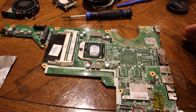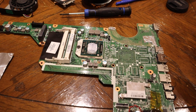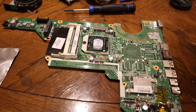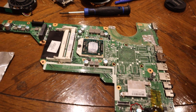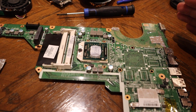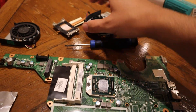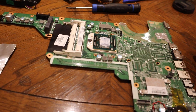My silver laptop did better - it was a newer laptop - but it finally got worn out, and I thought rather than buying a new laptop I really missed my old purple one and how well it worked. I did some stuff to it and the startup time went from 30 to 40 minutes running Windows to less than a minute. One of the things that helps is addressing thermal throttling - when your CPU gets hot it simply slows itself down to avoid burning up. When I put this back together I'm going to replace the thermal gel; every time you open it up it's a good idea to replace it.